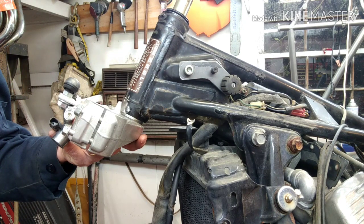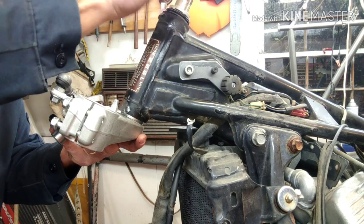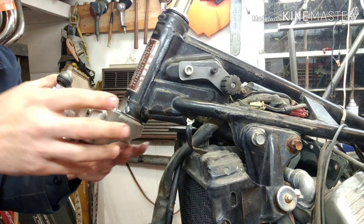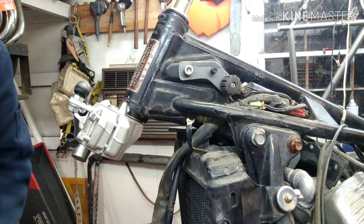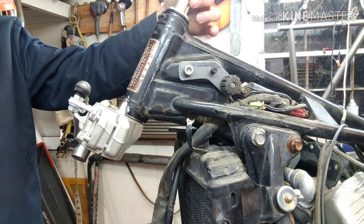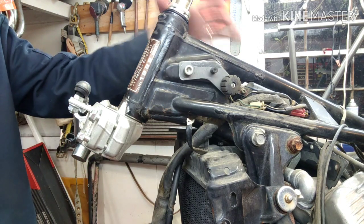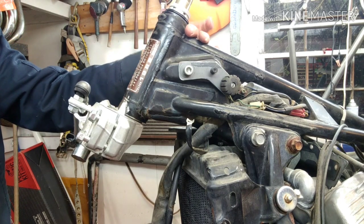On top of that goes the first nut. And this is the nut that adjusts it, okay? So this is the one that you're going to get your snugness from here. Now here's, I think, where we're going to run into a problem. We have the spacer right here, and then the lock nut's supposed to go on. Well, there's really no room for that lock nut. The threads are not coming up far enough. So nothing's going to lock this on.